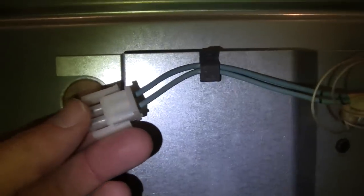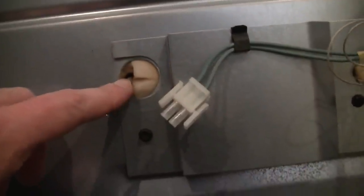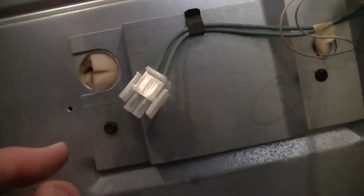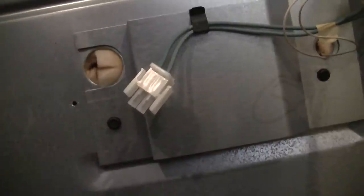I don't think it matters what wires are connected to what — they're not color-coded, not red and black or white, so don't worry about that. On the back of the oven there's a panel; take off some screws and it comes off, covering up the wiring. The broiler wire came out through a hole and the plug plugged in there, so the broiler igniter was easy to take off — just hanging by the wire. I unplugged it, snipped off the plug, and pulled the wires out through the holes.